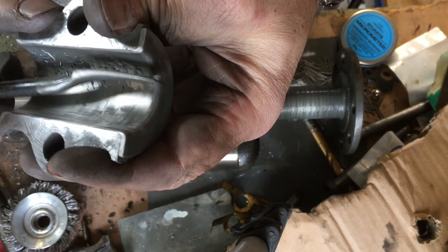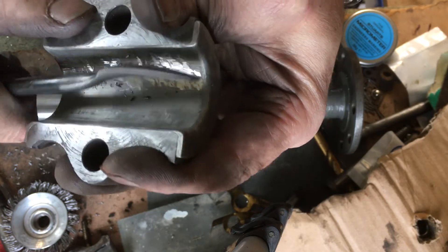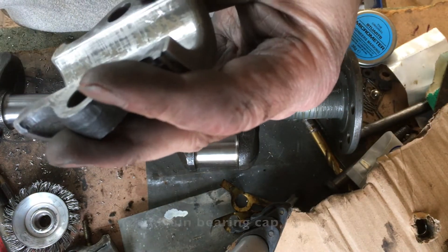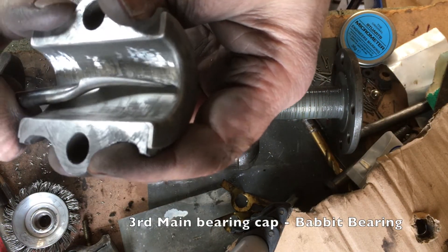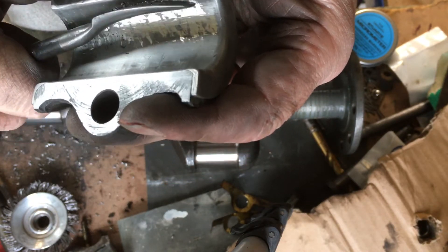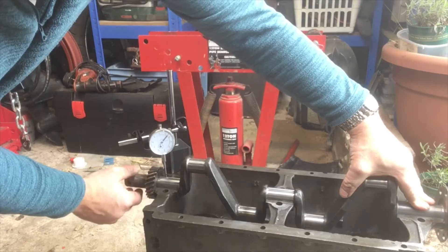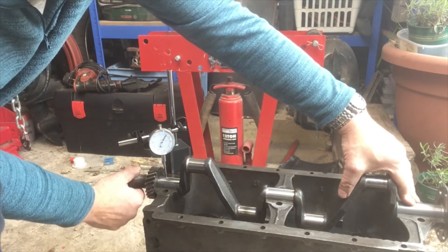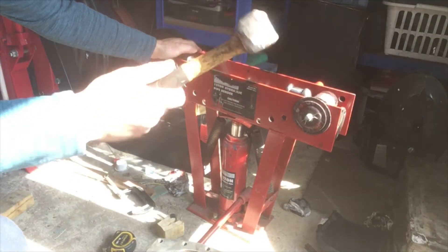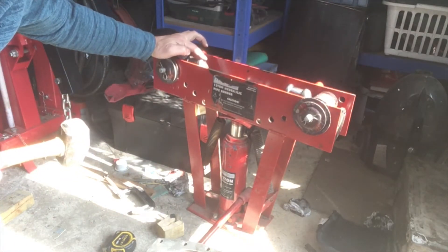After finding problems with the magneto and stripping the engine apart, I had to look at the crankshaft and found I had an end float problem of about 15 thou, which was just a little bit too much. I thought while the engine was apart I'd try and fix it, so I got a new rear main bearing — unfortunately it was 10 thou oversized, so I had to scrape out 10 thou and fitted it to the crank with a stuff called Time Saver, which did quite a good job. Unfortunately I then discovered a slight bend in my crankshaft, which was really quite irritating. I'd had the crankshaft tested for cracks and I thought for straightness too, but I don't think they bothered checking the straightness.